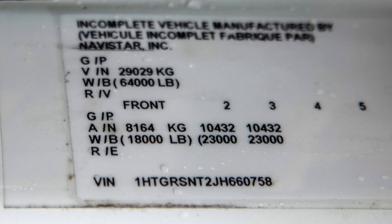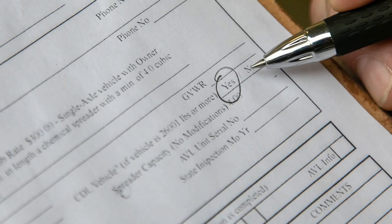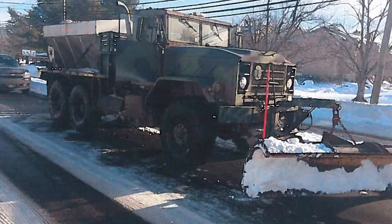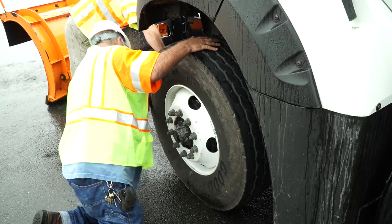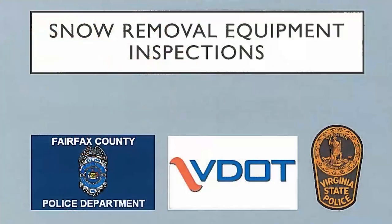No other stickers are valid. A vehicle can only have its GVWR downrated by the manufacturer, who will then place a valid downrated sticker on the vehicle. If the GVWR rating is greater than 26,001 pounds, circle the yes on the CDL vehicle line. Virginia law now states that military vehicles purchased after January 1, 2019 are restricted to limited use and cannot be used for snow removal operations. Military vehicles that are registered before January 1, 2019 can continue to be contracted. If you have any questions about conducting a snow removal service inspection or filling out the vehicle checklist, contact your residency administrator or your district maintenance manager.